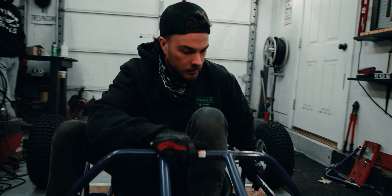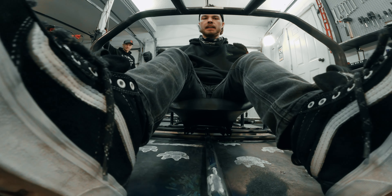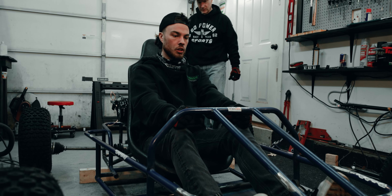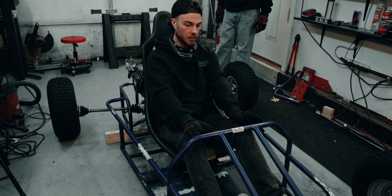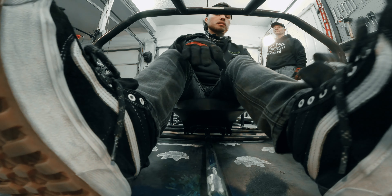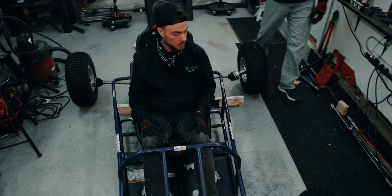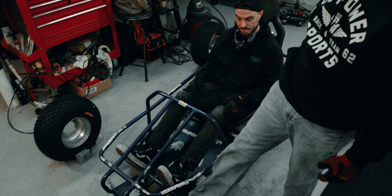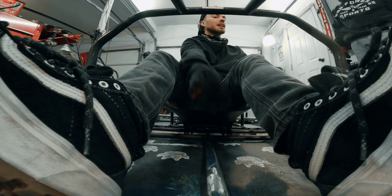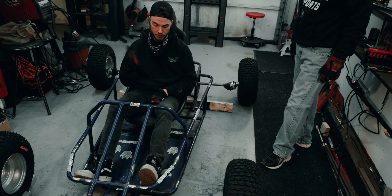This is as far back as the seat will go right now. Oh my God, we're so low! Why does this feel okay now? You still have clearance to the engine. The thing I'm gonna do differently here than our other carts — the A-arms are gonna attach out here, further out, so we don't have them pivoting in the middle, which frees up more pedal space. Could you extend the floor instead of cutting the whole cart? Yeah, and I think I'm gonna do an aluminum kick plate behind the pedals. If your feet slide off, they don't go out — that happened to me the other day.